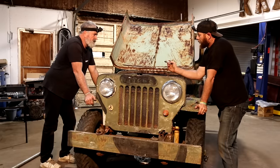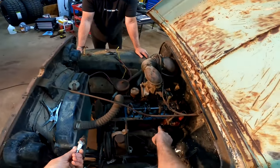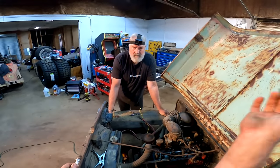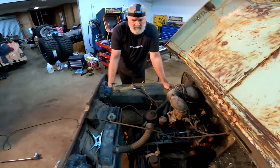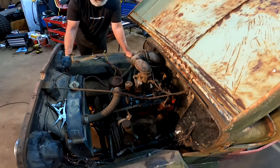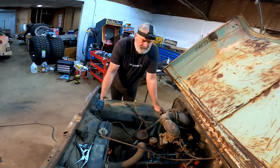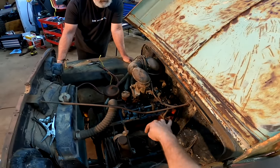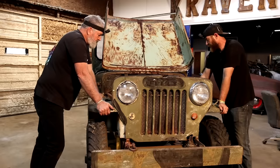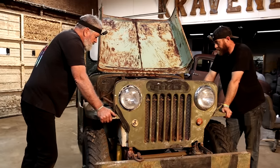You know, I don't know. All these spark plugs have rust where it's cupped there. And I just wonder if, from them not being in there tight and if the hood was left open, if it rained, it probably filled those things up. And then with it having the valves down there too, all those could be rusted as well. True, yeah. Because that water would have got down on that. Hope not. And the only way you'd really know on that is pull that head off, which I really don't want to do, but